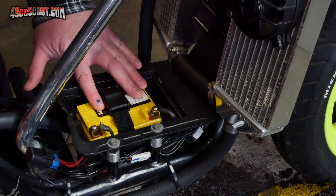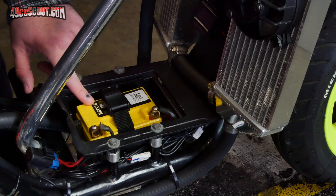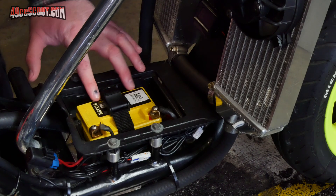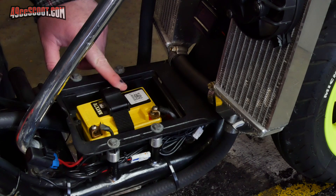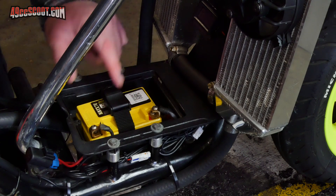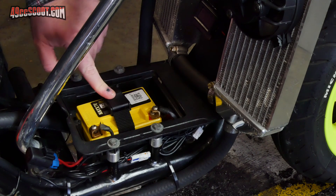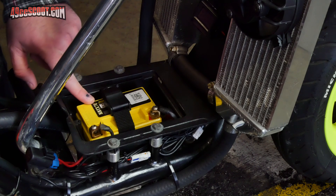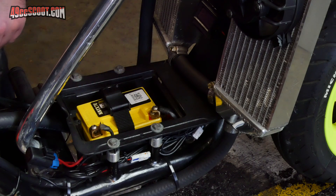So I replaced my old battery with this new Motobat MBT7XU — basically a replacement for the YTX7LBS. It drops right in, just has a little more cranking amps. The old battery was a 6 amp hour, where this is an 8 amp hour for the same size battery. Also, while I was at it, I went ahead and got a cinching strap, because I was using zip ties to tie down my battery, but if it comes to a point that I have to swap out batteries to ride very long at night, the cinching strap might make it easier and faster.